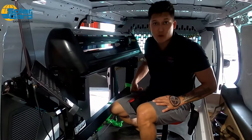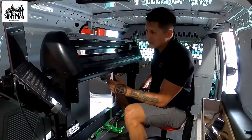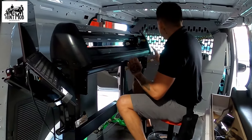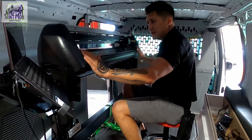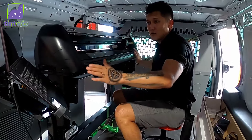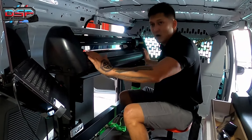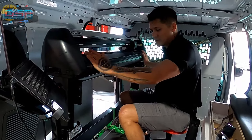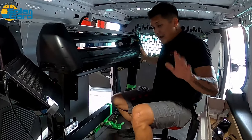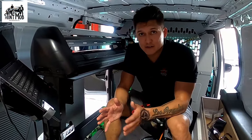We load the film in from the back end and then get into the van sitting in a shop chair. There's just enough room — I'm 6'1", so I have just enough room to set up comfortably. We plot the pieces here — usually just the doors. We'll do the passenger side doors, then the driver side doors, and then cut the back window on its own and put it on the glass for sedans and coupes.